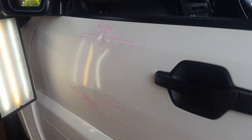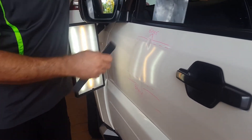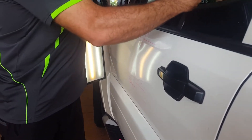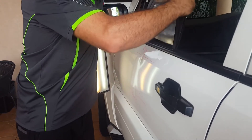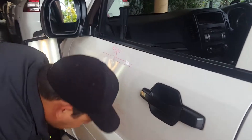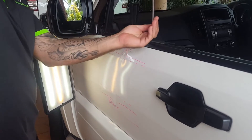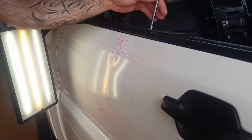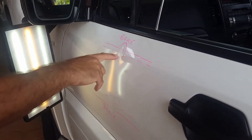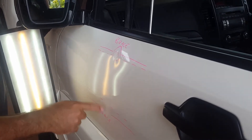So how we're going to do it is straight through the door opening. I'll put this felt covered shade on the outside of the window, drop the window gap, and use a tool like this to start pushing out some of this damage — it's all going to be pushed back out. I'll start by pushing out this body line and releasing some of this pressure, and the same down the bottom.